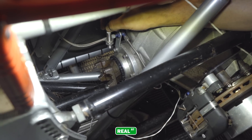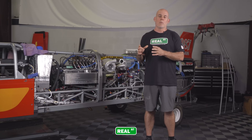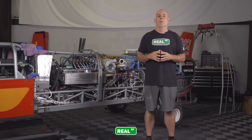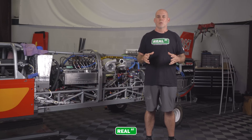Another thing that we're going to do to the car while it's here, which we'll feature in another video, is quality speed sensor input. The MoTeC has excellent traction control but it needs quality speed inputs in order to use that information to follow its slip aim, or the prescribed amount of wheel slip. So we need to make sure we're feeding the ECU quality data. What we had on the car before was a little choppy, so both the front wheel speed and rear wheel speed — we're going to fabricate and adapt quality sensors and make sure that we have a quality tooth pattern in order to get good data into the MoTeC.